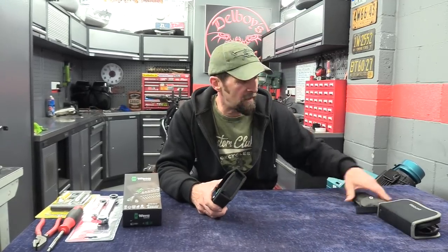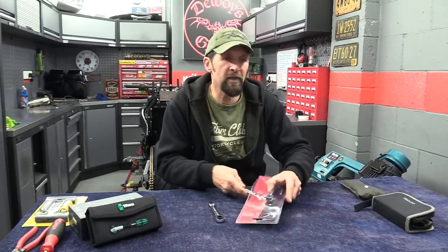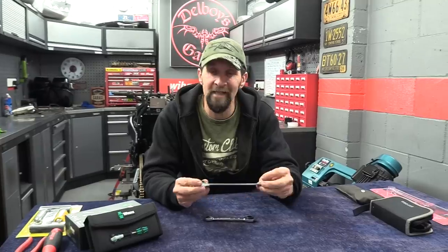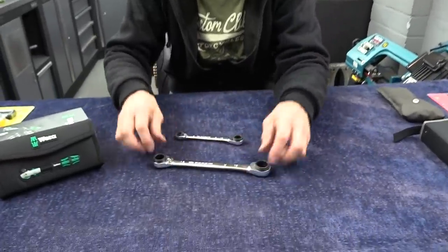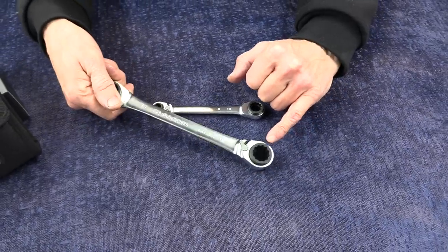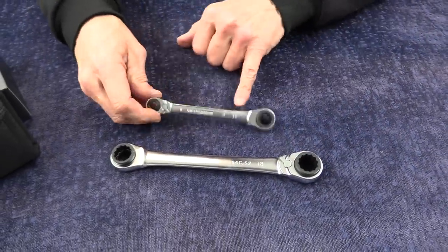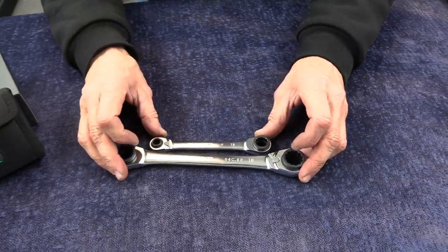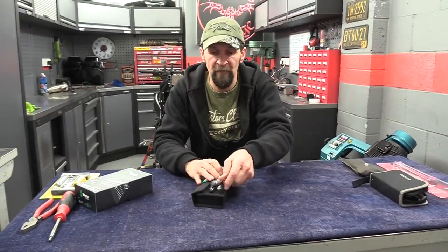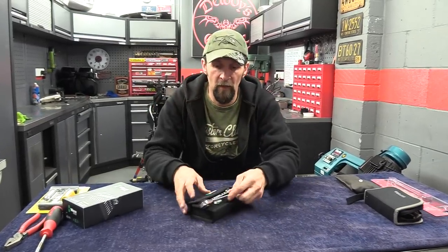There are a couple of issues though, both with this kit and the Oxford one: there are still no spanners. For spanners, I've got one of you guys to thank — when I was doing the swing arm bearing video some of you mentioned ratchet ring spanners. And yes, I do need them. These particular ones are amazing because they've got four sizes per spanner. They're Facom, really amazing quality. You get one size either side of the head: that's 19 and 18 on one end, 16 and 17 on the other; then 8, 10, 12 and 13 on the second spanner. So in just two spanners I've got eight spanner sizes — which really helps with a roadside toolkit because they take up barely any room.